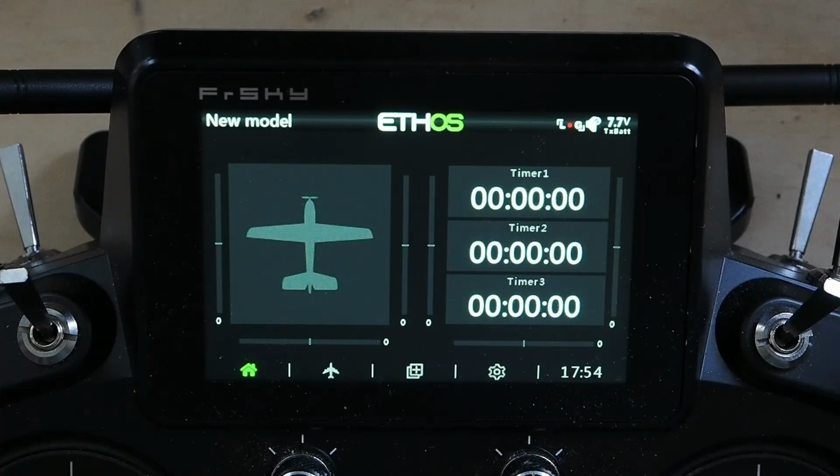On a glow engine with glow ignition, or for that matter a diesel engine if you happen to fly diesel, you want your throttle cut to completely close the barrel of the carb so that it prevents air from getting to the engine and therefore the engine from running. You then want your throttle cut off position being your idle position. You want that adjustable so you can adjust your idle. You want an adjustable idle on gas as well. And then you potentially want idle up on top of that.